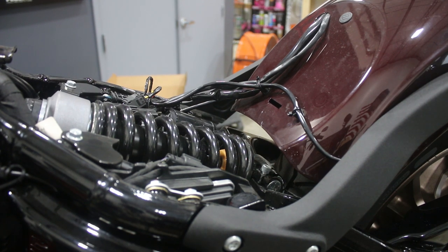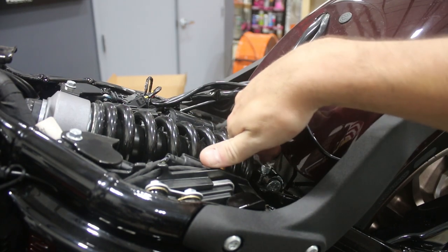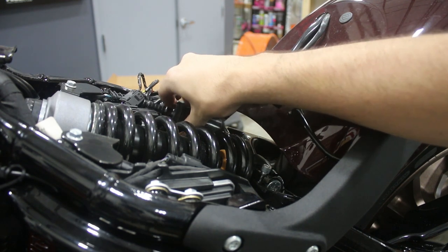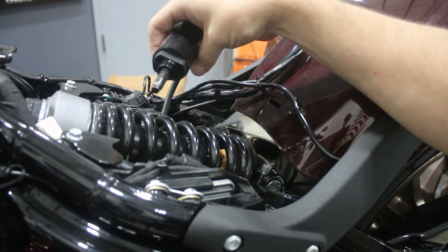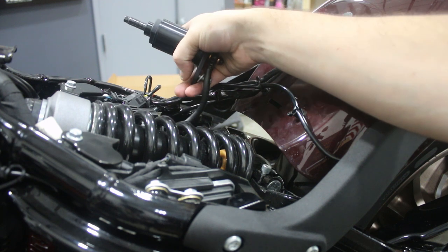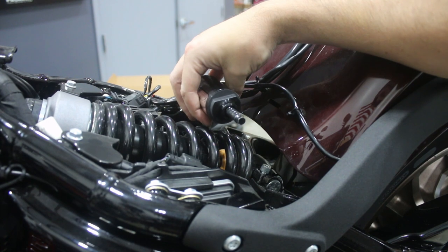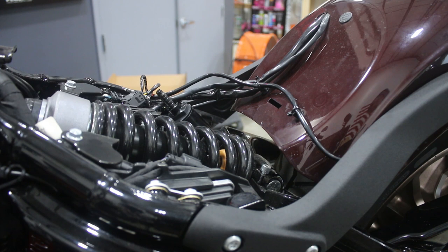This is where we're at in terms of disassembly — now I'm going to go through and remove our front bolt. I've already loosened up this pinch bolt, and then we'll remove the rear bolt and pull the shock out. Here is the adjuster for the factory shock. On some bikes this would live outside — like a Fat Bob, something like that. On this one, it's just bolted onto that crossmember that we took out. So while we do the removal, we're just going to lay this aside and it'll come out when we take the shock out.